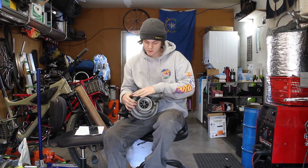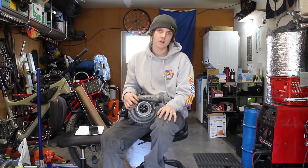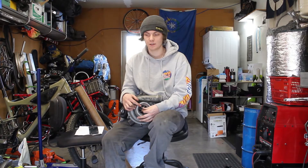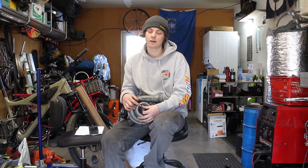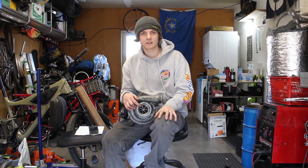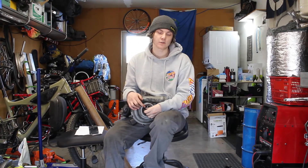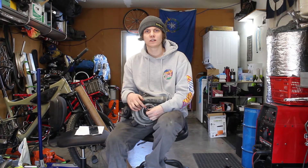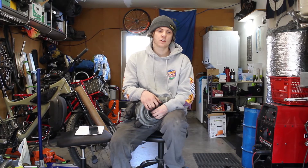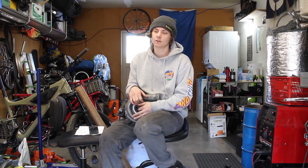What's up guys, today's episode is turbo stuff. Last episode did the oil cooler. Since then I built a short runner intake manifold partially, and I did a head gasket spacer — I totally forgot to film both of those, so that's my bad. Those are pretty easy things to find information about. GTI guys and VR6 guys know basically what a short runner intake manifold is — the stock one goes over the top and sticks out by the exhaust side, which is really inconvenient for running your intercooler and causes a lot of heat soak. So I built a short runner, then did a head gasket spacer to lower the compression down to nine to one, which should be good for boost.